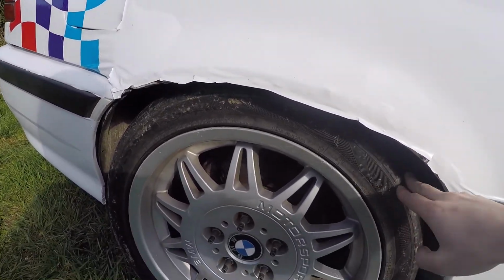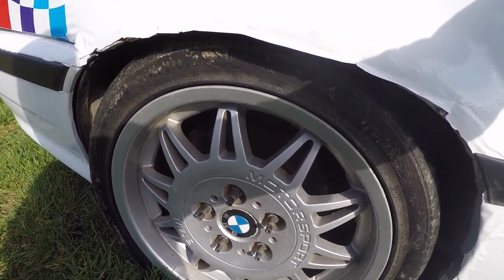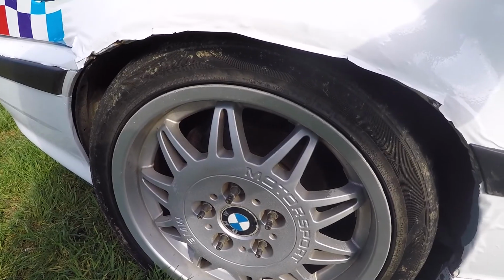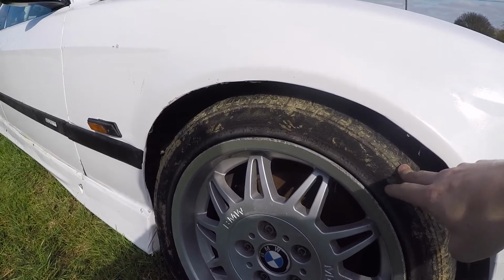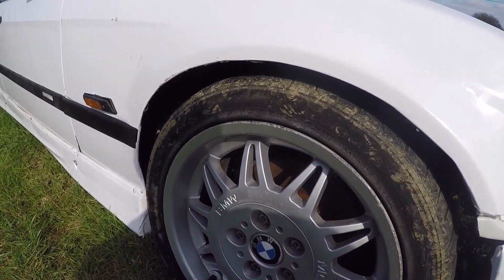So we've talked about tyres, we've talked about suspension. Brakes. On a light car that's not making a crazy amount of power, it's about 200 horsepower, I'm fine with standard brakes. And at the rear, I just run OEM equivalent. On the front, I run standard size discs, standard calipers, but I do have Ferodo, I think it's DS2500s.